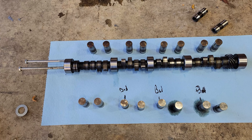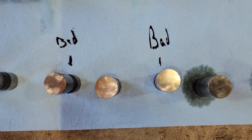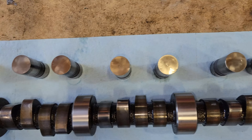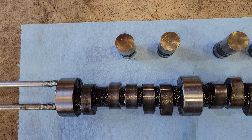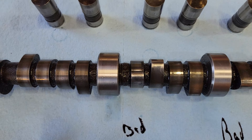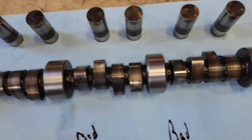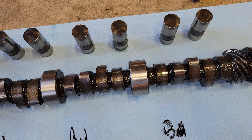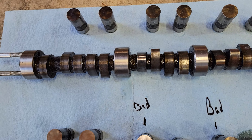Got the cam out — take a look at the lifters here. I'm pretty sure that this cam was bad before I installed it in the engine. I think the taper is just not there anymore. I broke this engine in for 20 minutes at 2000 to 2500 RPMs, and there's a bad lobe. Had oil temperature up to 200 to 210 degrees, and when I checked to see if the lifters were rotating, three of them were not. Made a mistake — cost me a bunch of time and money.